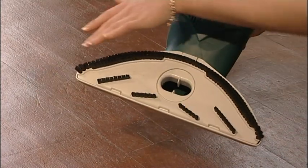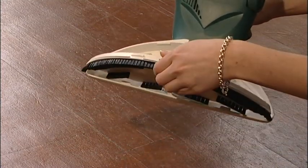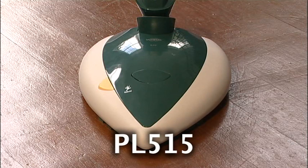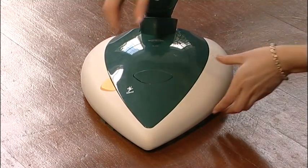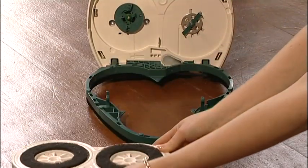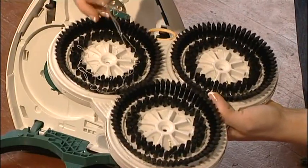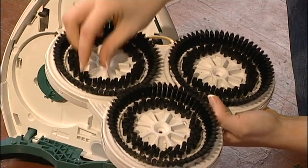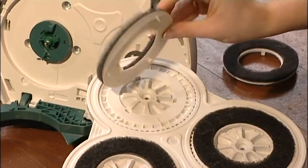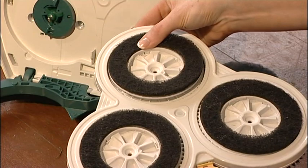The HD35 is a robust device and its tough bristles will last a long time. However, they'll eventually wear out and become inefficient. They can then be easily replaced by unclipping and removing the plastic plate and inserting a new one. You can carry out some simple maintenance on the PL515 yourself. To inspect the inside, press the yellow button and pull up the handgrip to lift the cover. Occasionally, the brush set holder may become loose — this is usually because the retaining pins have come out of position. Replace the pins in their grooves and push until they click back. From time to time, remove hairs and dirt from the cleaning sets. When they're badly worn, dirty or saturated with wax, replace them. Individual pads can be prised away from the pad holder using fingers or a screwdriver. New pads can then be inserted. Be careful to line up the three pins on the pad with the three holes on the pad holder, then push until all three click into place.